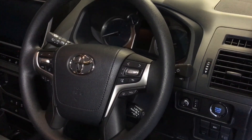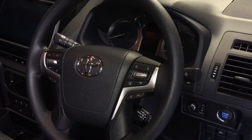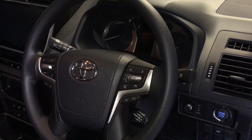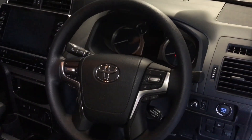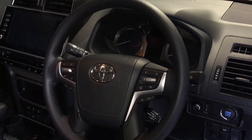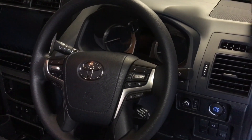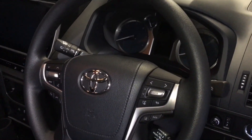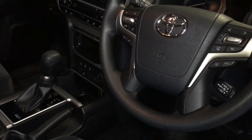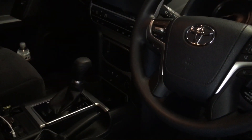This 2022 needs monitoring the least of any vehicle I've ever owned. Next least would be the 120 Prado — like the 150s with a five-speed behind the 1KD. Next would be the Hilux, which is why it's got the scan gauge. Then the 2019 — any of the 1GD six-speed autos — they are slipping their heads off and won't be any different to what the 2019 was. Those are the ones where you really want to monitor the auto temp or get an auto cooler on it.